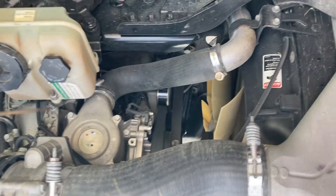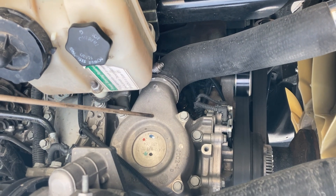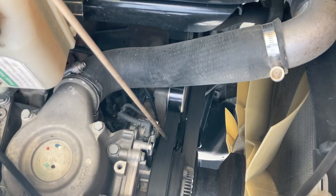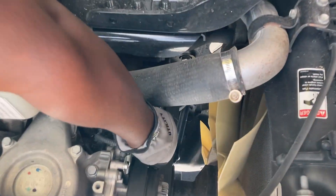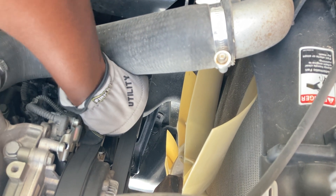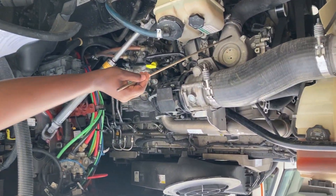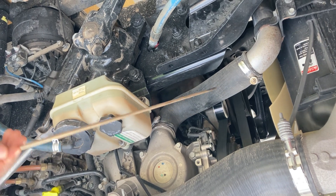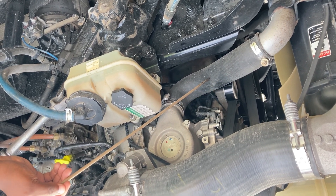Coming across, still following my path, I'm coming to my water pump. My water pump is securely mounted with nuts and bolts present and tight — it's not cracked, broken, or leaking. My water pump is also belt driven. My belt is properly seated — it's not dry rotted, broken, frayed, cracked, or cut, and there's no more than three-fourths of an inch of push or play from the center. Running right into the water pump connection is the water pump hose, which is properly mounted with clamps that are present and tight. No abrasions, bulges, cuts, dry rot, or leaks.